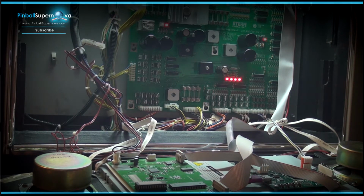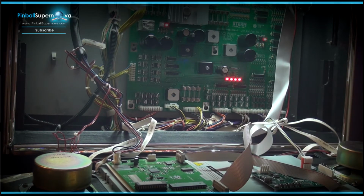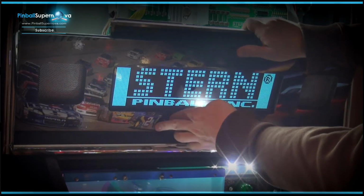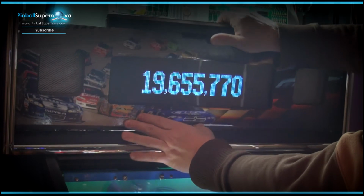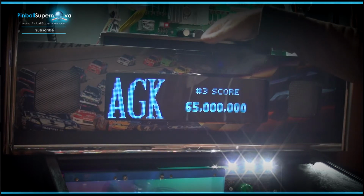And then the memory stick is formatted with FAT32, which is a format with Windows, and that's I think what ColorDMD recommends, not NTFS but FAT32. So that usually works. And then when it's done, the light is off of the program. We're going to take out the memory stick, and then everything should be updated. We might have to rechange our settings again on the ColorDMD once we look at it. Yeah, because it reverted back to the dots. So we'll just go back in again.